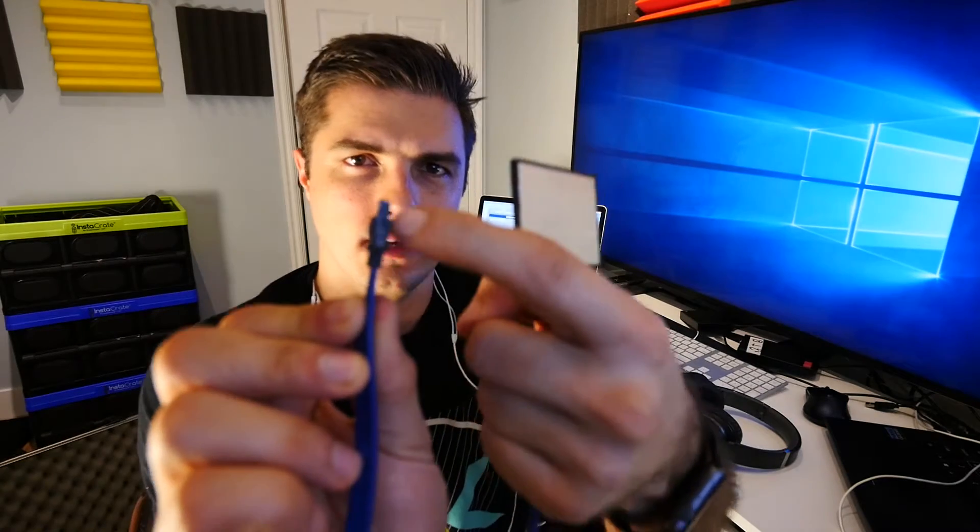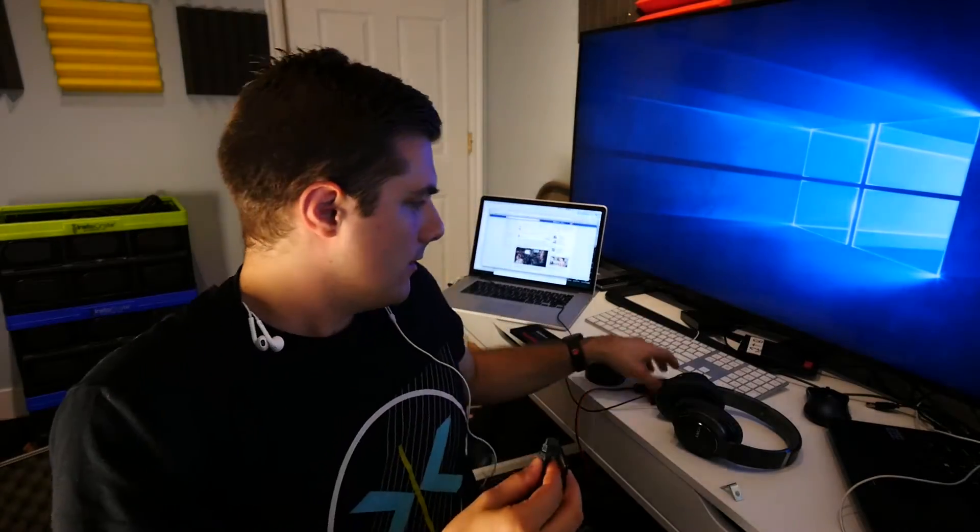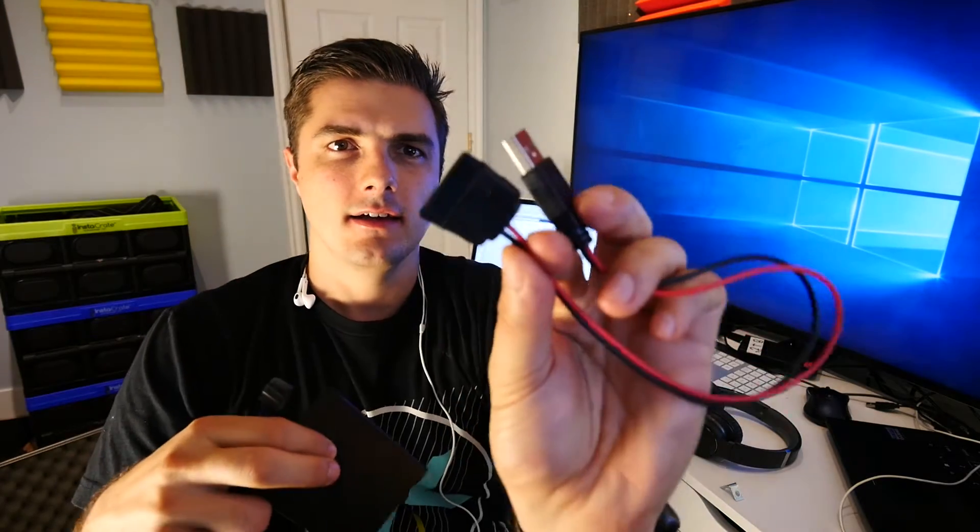What I've done is I went and razor-bladed off the power portion of this cable — you can see that — so that I could have space to plug in a power portion. Andrew was kind enough, he actually brought one of these with him. He had an extra one and said I could have it. It's just a USB to eSATA power port, which is perfect because the USB is the five volts, exactly what you need to power these little SSDs. I shaved down the data port side of the cable so they fit together.